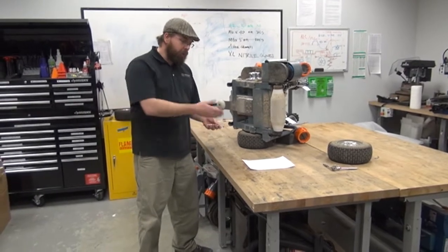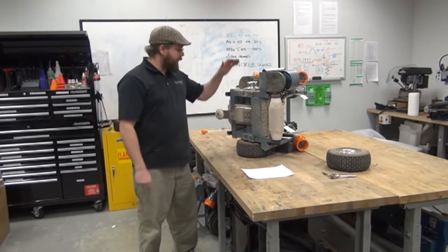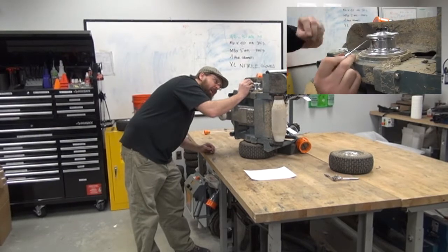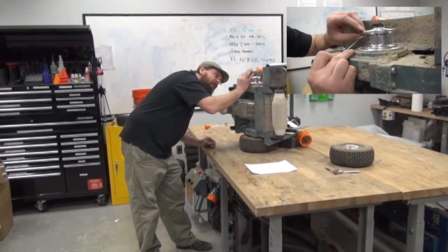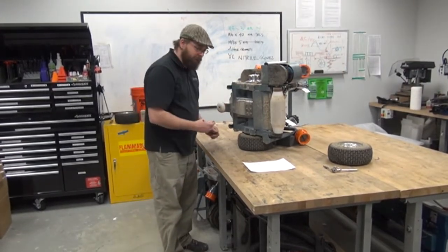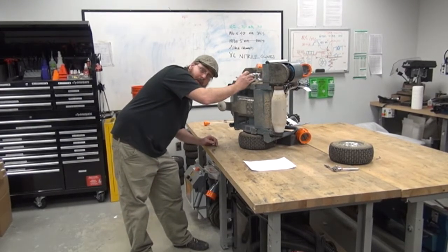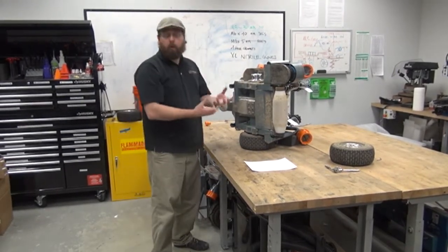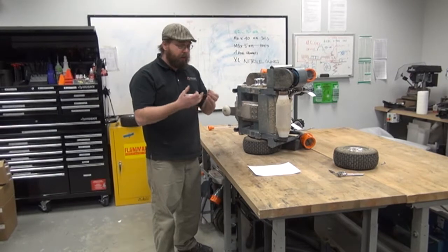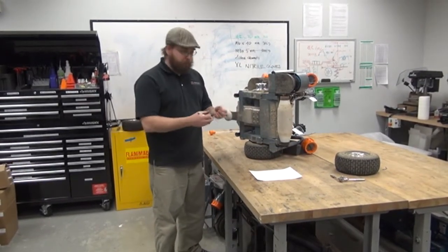To remove the wheel, you're going to refer to the documents listed in this inspection. Then you're going to inspect in here using a very fine pick — you're going to look for pieces of material and pick out anything that's in between the hub and the bearing housing. You'll know when you're done when you can see a little bit of daylight between those two pieces. This material picks up dirt and can erode the seal on the bearings, eventually destroying the bearing by letting foreign material in, which gets expensive.